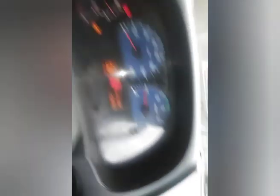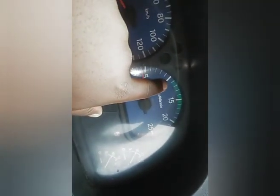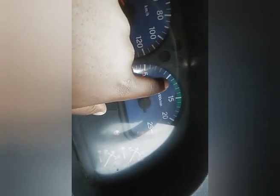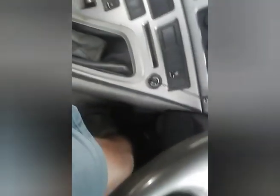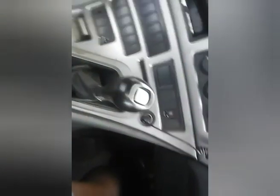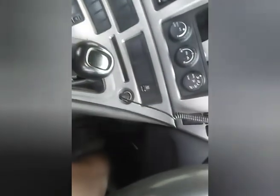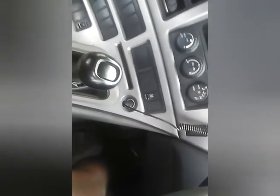It's eight low now. As your revs drop around 10, go to seven high. As your revs drop to around 10, just switch the range — press down like it's slow range — then press your clutch.